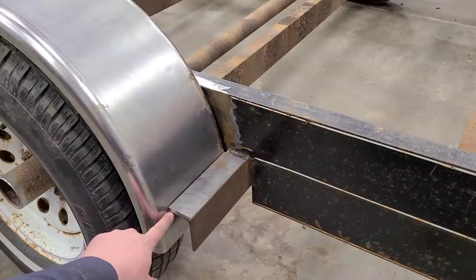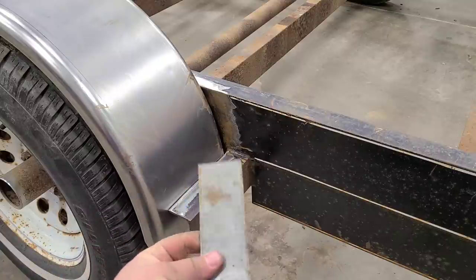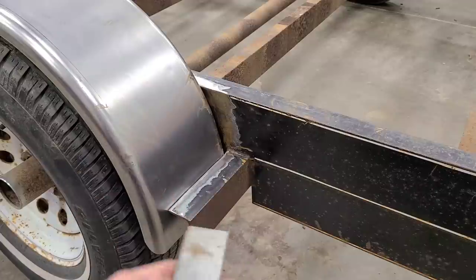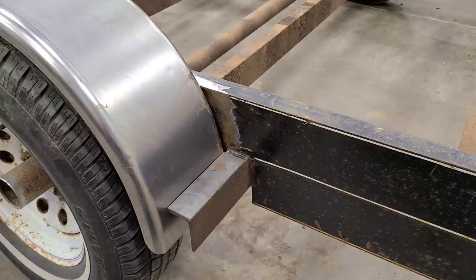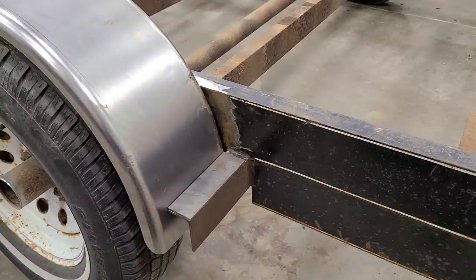Okay, here's the plan. I got my 3 inches from the bottom of the fender to the top of this angle. I cut these flat plates — they're just 3/16ths by inch and a half, or maybe 2 inch. They were scraps left over from a different project, but they fit nicely in here. I haven't decided if one or two bolts in there. Before I actually mount this after we paint, I will stick a piece of rubber in between there just to dampen it a little bit. The fender is actually wedged in here right now — once it's in position it doesn't fit that tight, and that's the only reason for the rubber being in there.